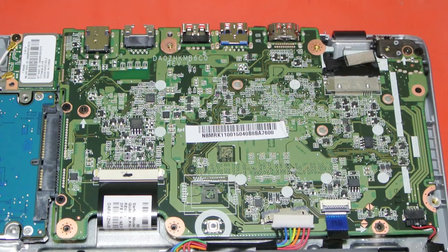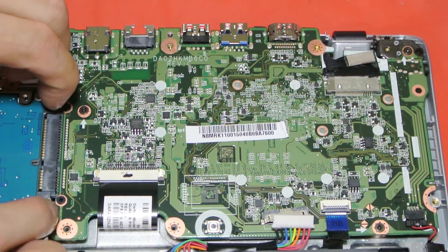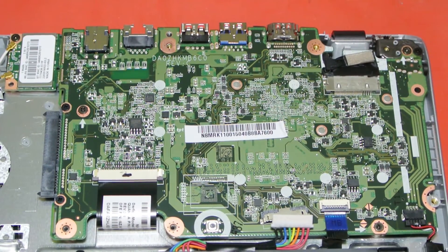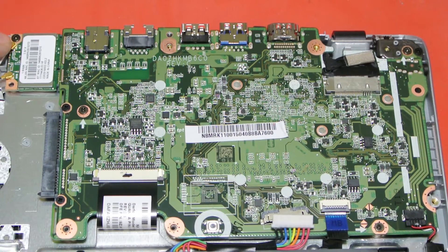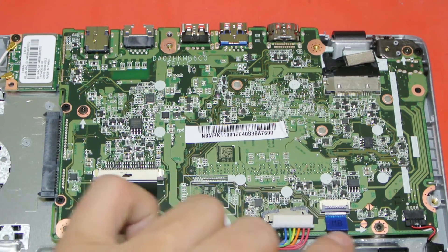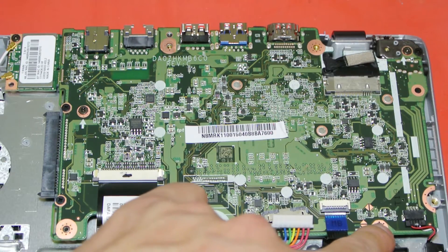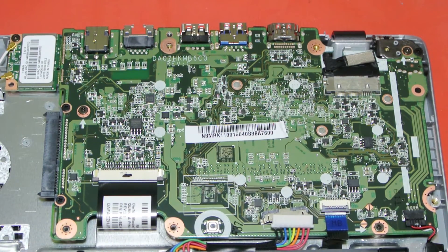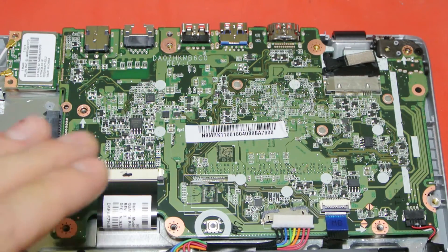To perform a RAM upgrade it's a little bit trickier — it was easy to get into the laptop, but for RAM you need to remove the main board. You really do take this at your own risk; it's not that difficult. First, slide the hard drive out of the way and remove it, and make sure the battery is disconnected as shown earlier. Then remove the screws: one here, two here, one by the hard drive, and one down by the battery — that's five screws in total. The rest is held by pins.